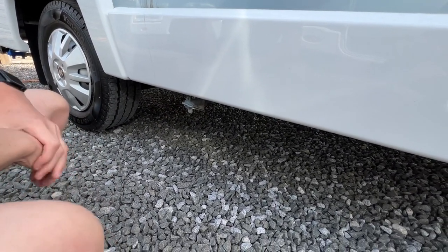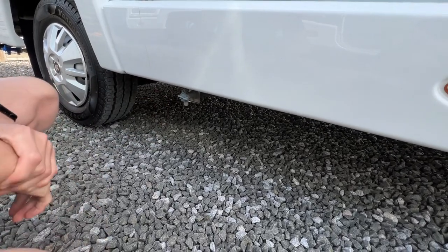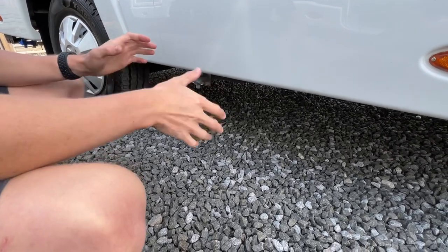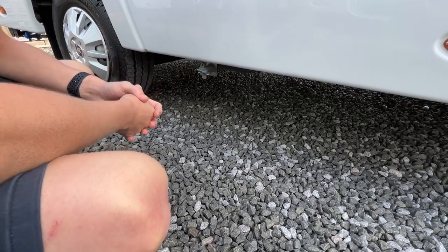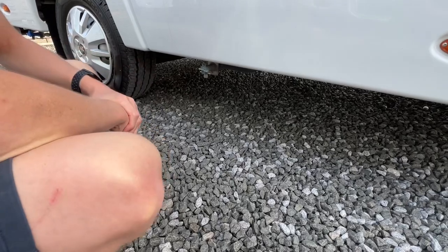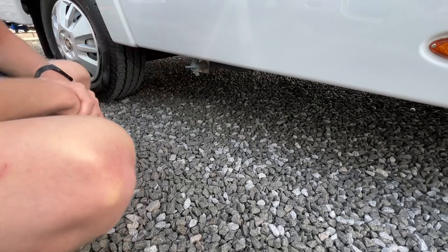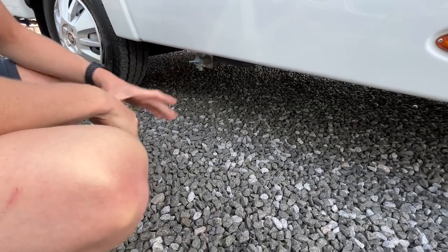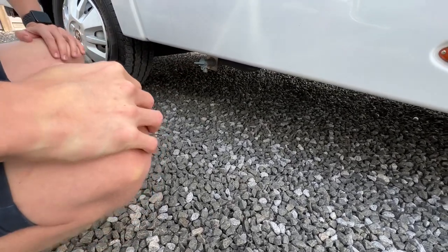This vehicle has a holding tank on board of about 70 litres of waste water. However, you don't want to be driving around once you've left your site with a full tank of waste water, because that's approximately another 70 kilograms on your payload. Drive over the site — some sites have a grate, some you've just got to get as close to the hedge or verge — open the tap and allow your water out. Make sure this is fully drained off in the winter and the tap left open to avoid water freezing in the tank and causing frost damage.